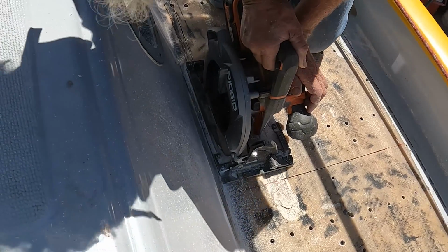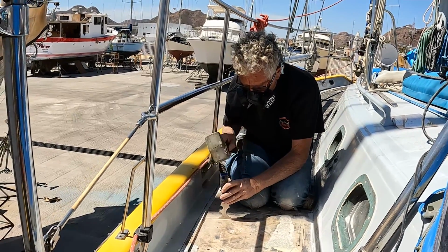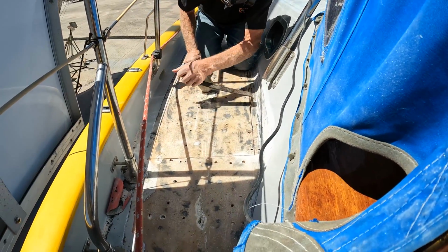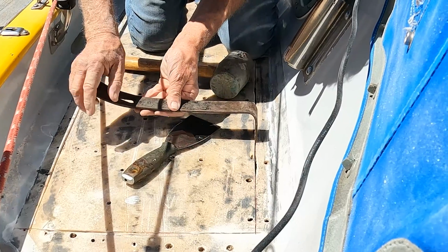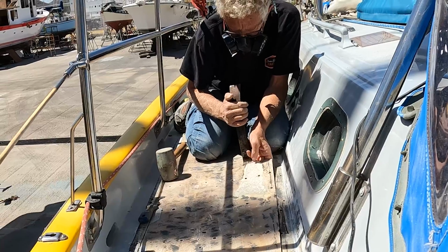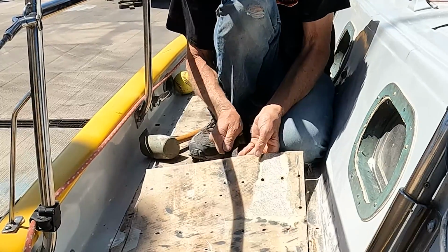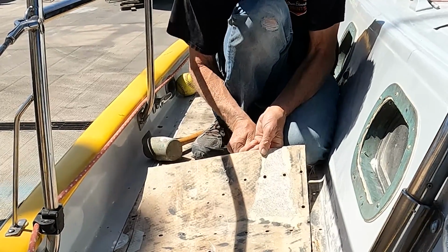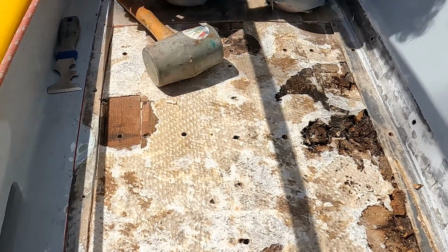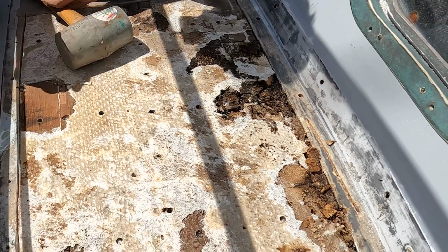Last week, when Lee removed the fiberglass skin towards the stern on the port side, we realized we had removed too large an area of skin. Look at that. It was unwieldy to pry up and did not come up as easy as the ones in YouTube videos. I guess that was a good thing, indicating lack of delamination and drier wood. It was only along the cabin edge that we found rot and a slight amount of delamination.